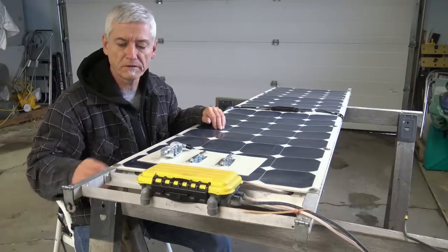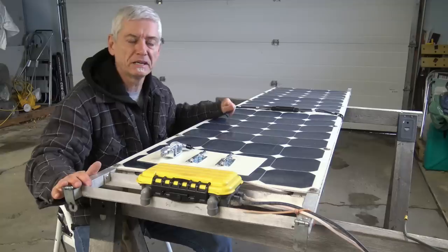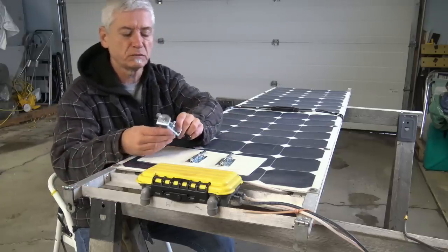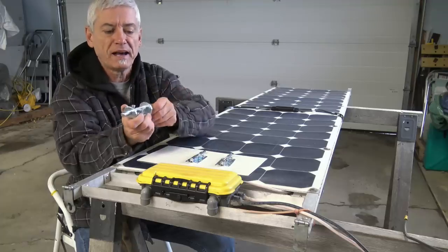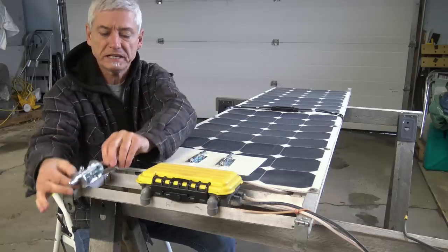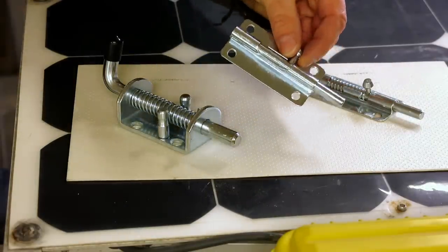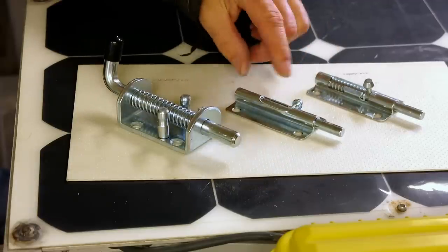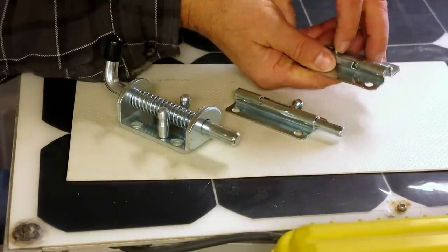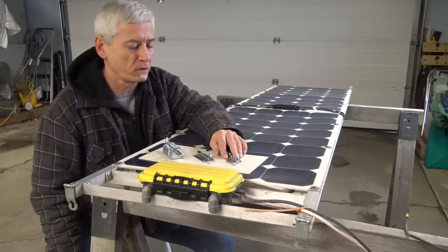One of the first things I wanted to modify were the latches at the end, because the ones at the far end — up at the peak of the A-liner — I can't take them off without lowering the trailer. My first instinct was something like a spring latch, similar to what they use on farm fences, but it was very big and bulky — a little overkill. So what I did was take regular barrel latches like you see on a home gate, cut out a section, and add a spring. It springs back and I can lock it in place. I think these spring latches will work well for my purpose.